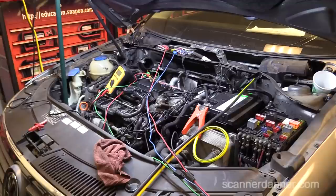So if we were in the field doing this job, would we want to keep going? Yes. Could we use our cam-crank relationship? I'm already on the cam-crank. I can ground the circuit and get a cam signal, then look at cam-crank to see if the timing belt is on right. Off camera, we re-jumped the sensor ground circuit - the one reading 4.1 volts at the computer - and grounded that so we could get a cam signal. Go ahead and crank it and hopefully we can find a known good waveform to compare.